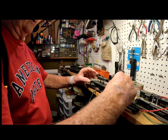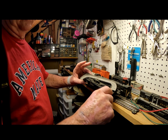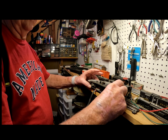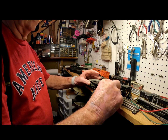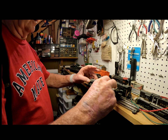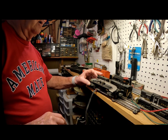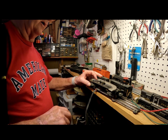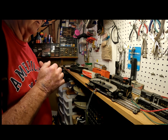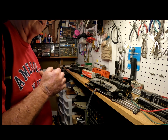The main repair on these things is right there in that little circle. There should be a little rubber grommet that this sits on and helps it absorb some of that vibration. And most of these old things, they have deteriorated and fallen out. So that's where we're going to start. But to do that, we need to clean those spots up really well, because these little rubber pads are self-adhesive. It needs to have a nice clean surface.